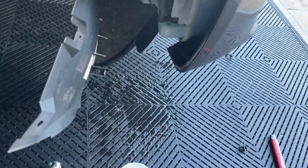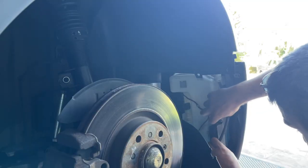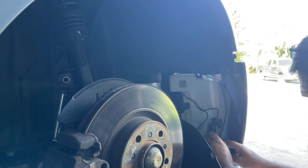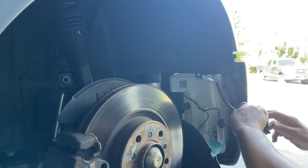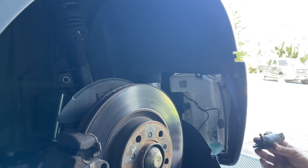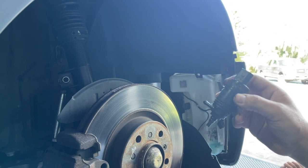So I'm going to pull this solenoid off. I've got these little pans to catch the little bit of windshield washer fluid that's in there. Just lift up on it and it'll start gushing out the fluid. And there's your solenoid — I'll disconnect it. The part is only like $13 to $15 dollars. I'll put a link down in the description below if you want to grab one. This is what we're replacing — I already have one on order, hopefully it comes today.